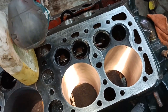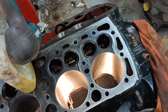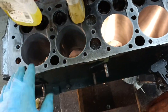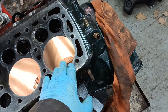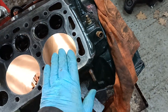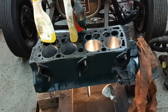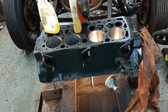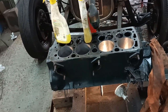I thought I'd taken it out too big at the top. I thought I'd basically scrap the job. And that was the third one I did. So I very, very carefully checked all my measurements when I did this one. And this one's come out okay. What I need to do now is hold it up on the engine hoist, flip the stands to the other side, and repeat the process on the other side.